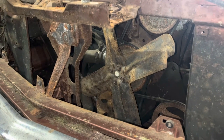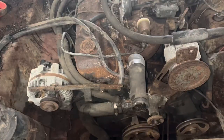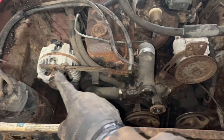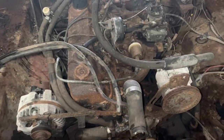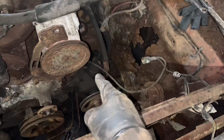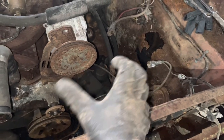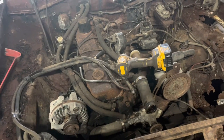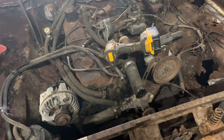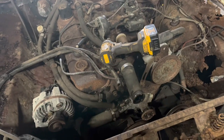Now would be a good time to yank the fan and probably the belts. We've got real easy access on this one — it's four half-inch bolts. Depending on your situation, you may want to pull accessories. The alternator on the Slant 6 hangs way off to the side, so I'm going to remove that. I also need to unwire the engine, which is real easy — it's about six wires. Seven-sixteenths, half-inch, and nine-sixteenths sockets, wrenches, or even ratcheting wrenches will get you a long way to taking apart one of these cars.